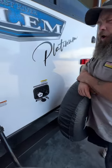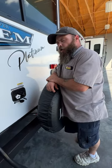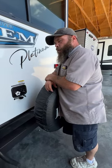Over here is your city water hookup. It is always recommended you have a pressure regulator on the water spigot. From there you have the option of an inline water filter, then your blue or white drinking water hose hooks up to this — and you're ready to use the water system right away.